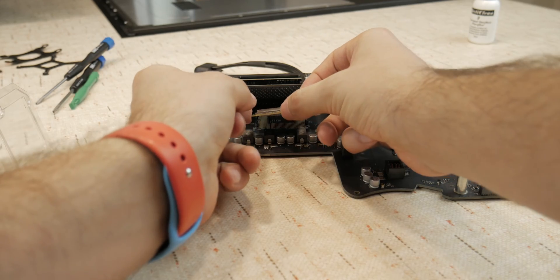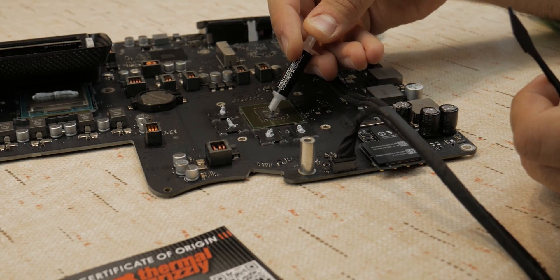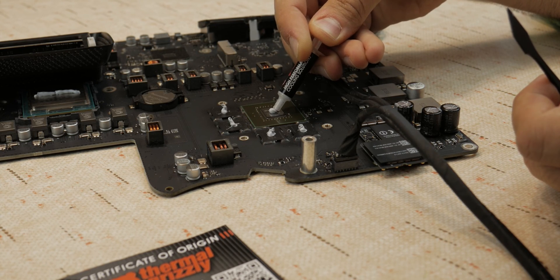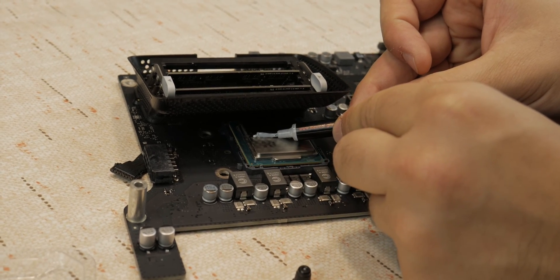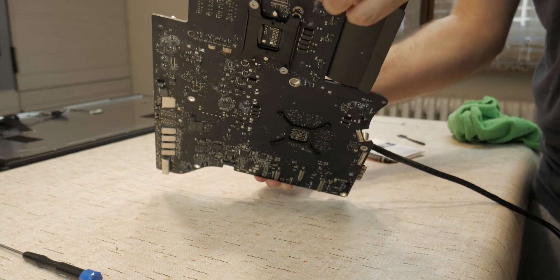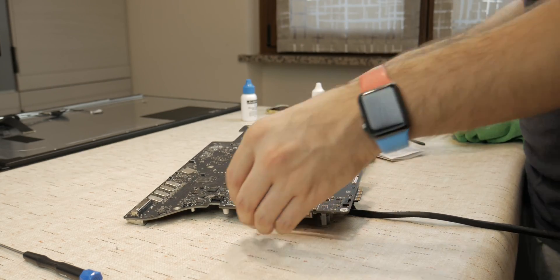Before reassembling, you need to clean all the copper and heat exchanger parts with a microfiber cloth and cleaning products like Arctic Silver, then reapply the thermal paste. I use thermal grease because it has better conductivity, though it's more expensive. Be sure to use enough of it, as top-tier CPUs hit turbo boost immediately and you want very good heat exchange. Then carefully put everything back together and power on. After a few scary moments the Apple logo appeared and we were safe and sound.